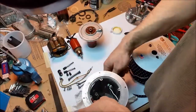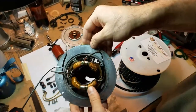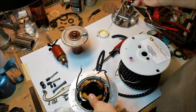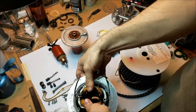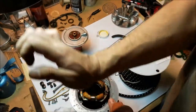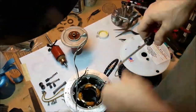I then tug on the cord to make sure it won't come out. Now I'm really installing the field coil. I'm using a coat hanger to align the screw holes. I had previously filed down the inside of the motor housing to allow the coil to go in and out easily because I had to hammer it out, but as you can see it didn't go in easily, probably because of the motor varnish. It also doesn't align perfectly and takes me a while to get it straight.